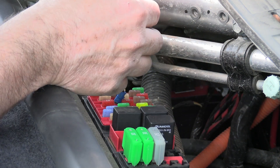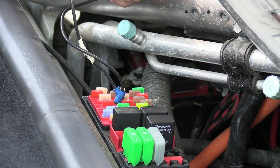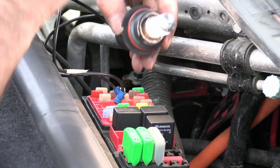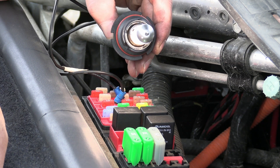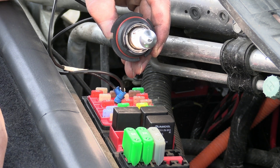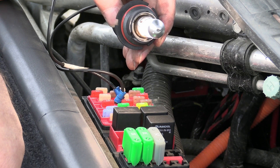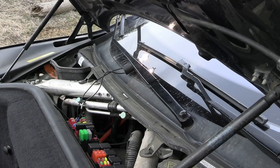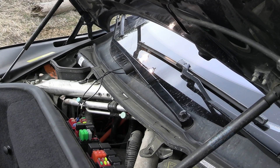Now you want to make sure you don't touch the glass part of the light bulb, and wherever you put it, make sure the glass part doesn't touch anything. It's best if you can bring it up somewhere higher, or wherever you can actually see it when you're working on the car. That way, if you sometimes have a short inside a wiring harness, you touch the harness somewhere and the light goes off while you touch it, then you let go and the light's back on — you want to be able to see that. The longer the wires, the better. So you can see I was able to clip this light bulb on the windshield wiper arm, and that should hopefully allow me to see it from the back door area.